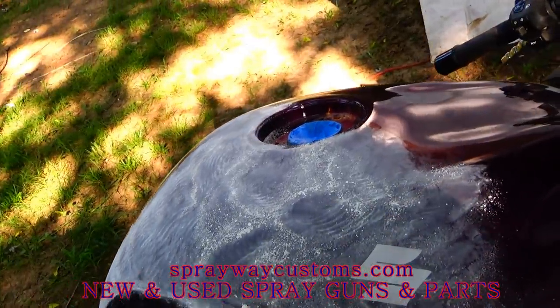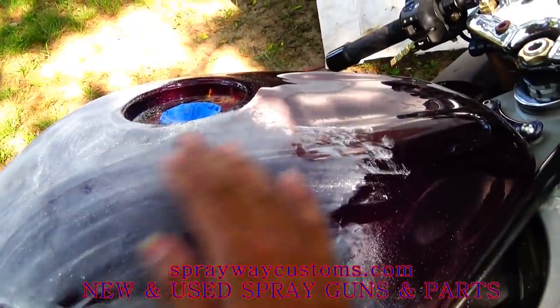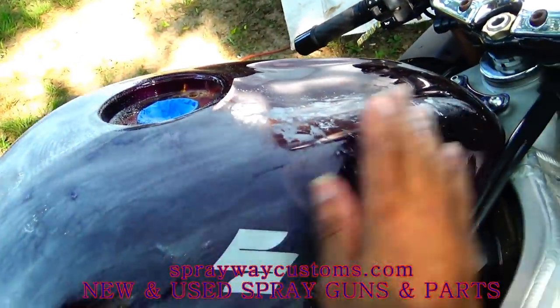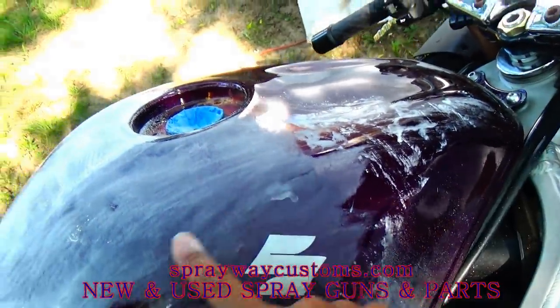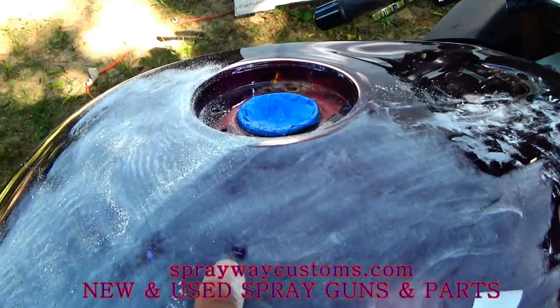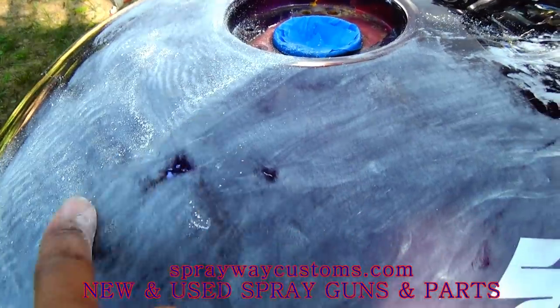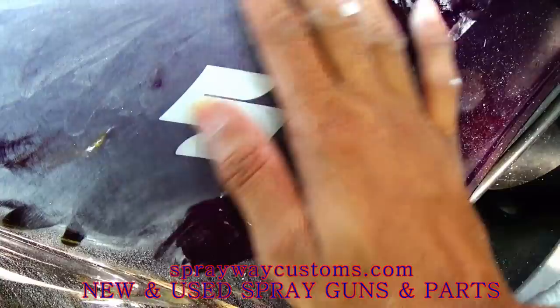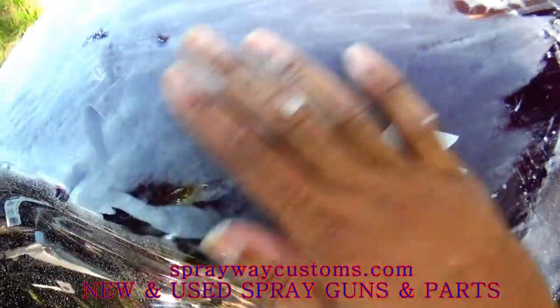All right, let me show you what I'm doing. See what that 320 will do for you. That's all you need. That primer gonna stick to it real good. I gotta hit this spot over. Anywhere you see where it's shining, you gotta go on and dull it.